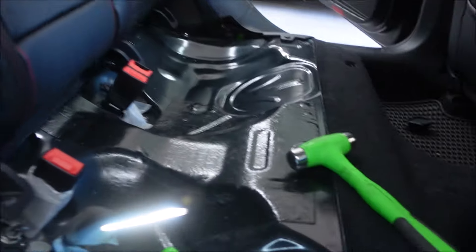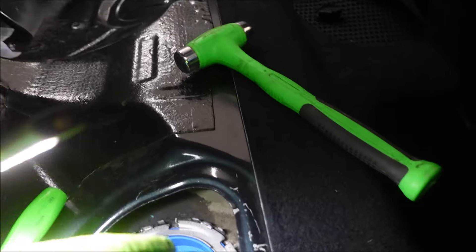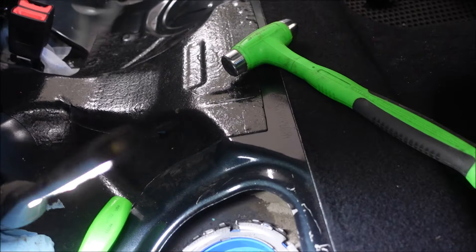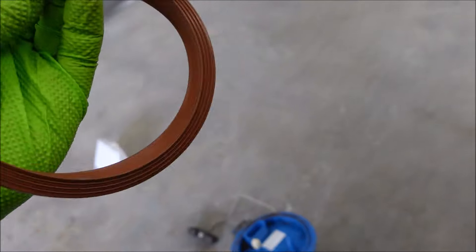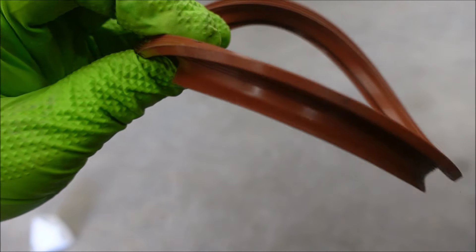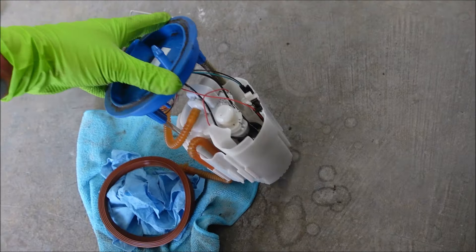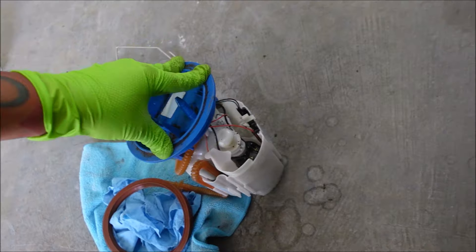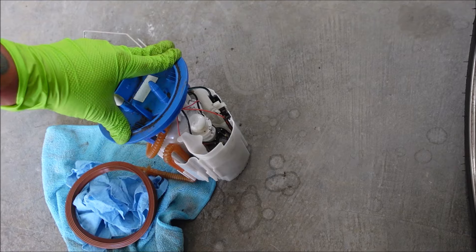Basically, drop the new pump in there, hook up the hose when you get it close, drop it in, get it down in there, then put your float back on. I found that with my new gasket I couldn't get the pump seated in there — I put the gasket in the tank first around the lid, but this one didn't fit very good and the old one fit way better. When you drop the pump down, this is spring-loaded, so you have to push it down — it's going to hit the bottom of the tank. You have to push this down to get your retaining ring on there.